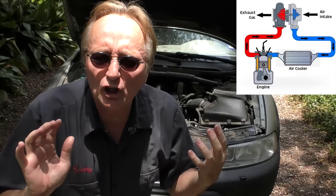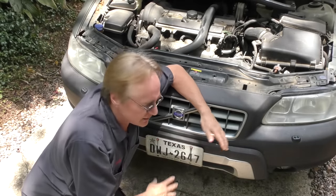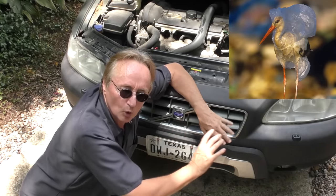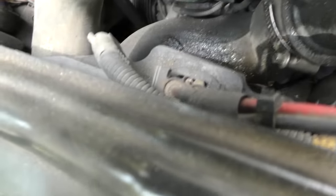If you have a turbocharged system with an intercooler like this Volvo, make sure the intercooler is working correctly. If you drive in the country at night, bugs can get in there; in the city, plastic bags could restrict airflow. Hose it down with water if there are bugs on it and ensure nothing is restricting flow. Also check the intercooler lines — the plastic sections can crack and the rubber sections can rot or come loose. If there are air leaks, it will mess with the air-fuel mixture, so check them periodically.